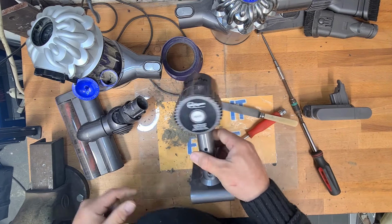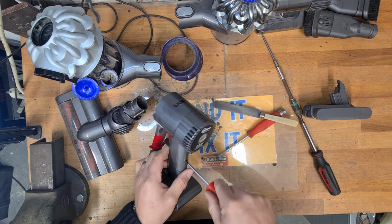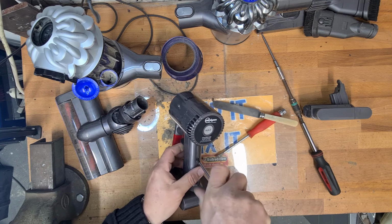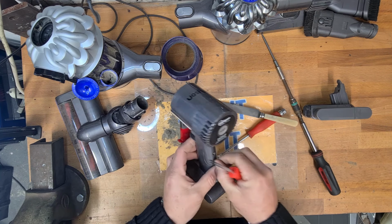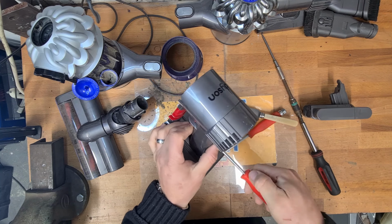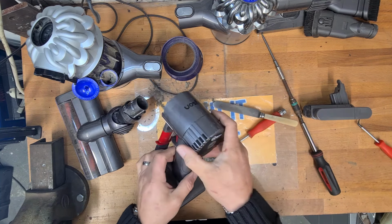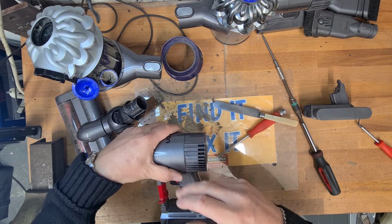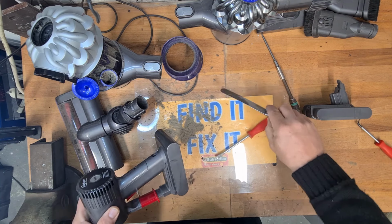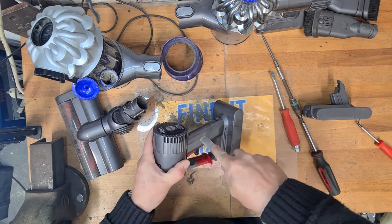Now, onto the motor head. There's a small Phillips screw just in the back of here. All we're going to do is undo this. Now, like I say, I did a video showing you how to replace this with a HEPA filter. So if you take yours apart and the filter in the back of this is completely disintegrated, you can buy a HEPA filter off of eBay for just a couple of quid. I'll leave a link in the description below.